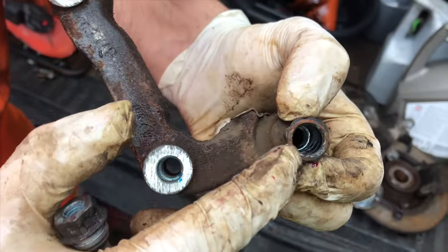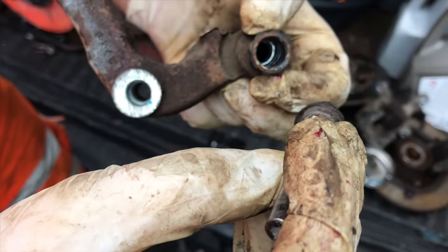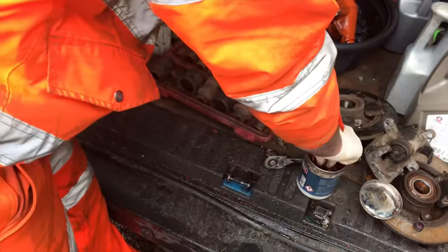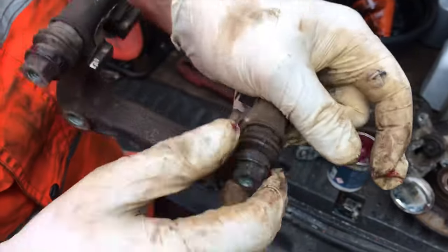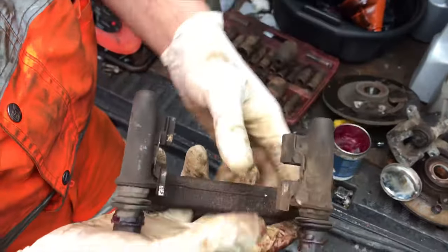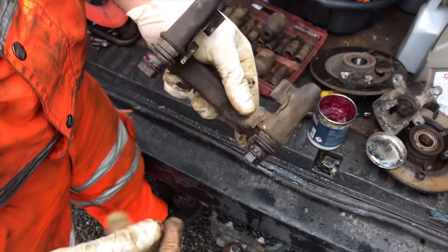You can see here there's a little bit of corrosion build up just on the top of the head of the bolt. It's not bad enough to go around and clean it, but you can see that's like an indication of where it could start. Grease up the slide pin — as you can see, you don't need loads, just enough to keep it moving. And that's that done. Now we'll clean up the abutment clips. I always like to grease the slide pins first and get that sorted, and then no dirt can get inside there.